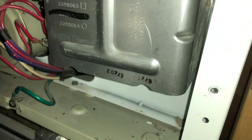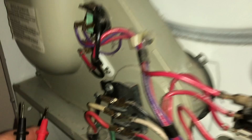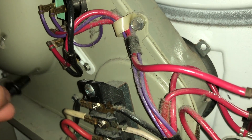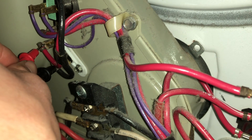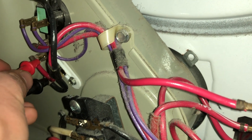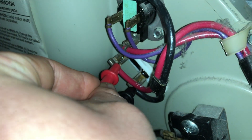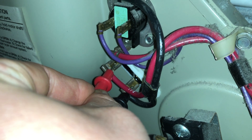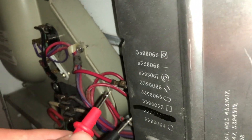You're going to want to hear the beeping or non-beeping sound when I touch both ends of the thermal fuse. This is one I already replaced, but my co-worker who's worked on this stuff before told me that if you replace the thermal fuse and it blows again, chances are it's the element. As you can see, I have both leads making contact and I'm not getting any beeping noise from the meter — so I have a bad thermal fuse again.